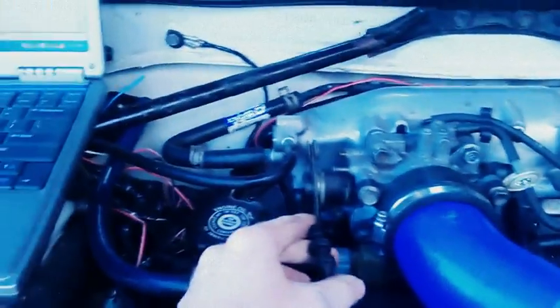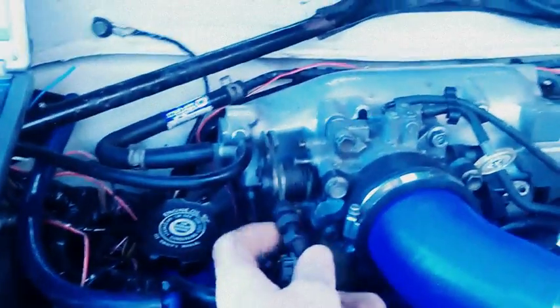Yeah, this is really exciting. My cruise control I can leave connected. I took the bracket off the bottom, and it's actually sitting on the top of the air intake pipe that goes into the turbo. All I have left to do really, aside from putting gas in it, is make a bracket. I've already marked off some aluminum that I have. I'm going to cut everything to size and bolt it in there on the side, run it out, and then get one of those little throttle cable clamps. I have one on an extra throttle body somewhere, from like a 5SFE or something like that, and then just bolt it into the side of the bracket and make sure it clears the hood so that I don't get any cuts on the hood.